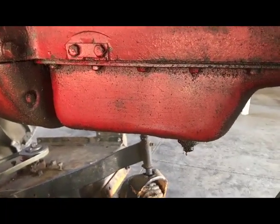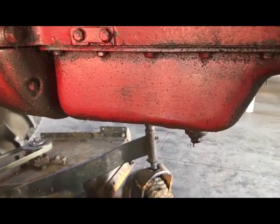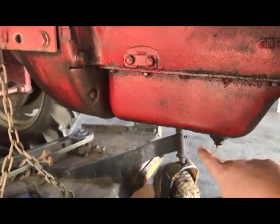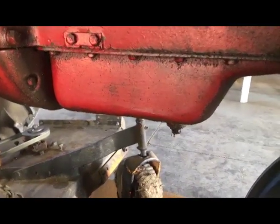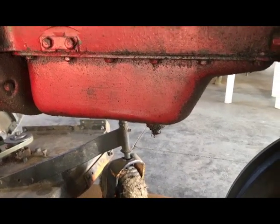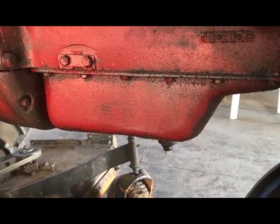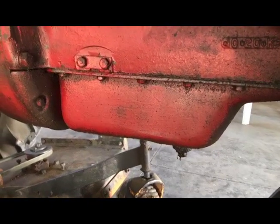According to the service manual it says you can roll them in in an emergency — it's not the best way to do it, which I know — but I want to at some point give this tractor a restoration. Right now I'm mowing with it and I kind of need it for that. So I'm gonna pull the pan and take those main bearings off and see if I can get some measurements and figure out if they're getting loose. I hope my crankshaft is in good shape. It feels to me like a motor where they did a top end and then didn't do anything else because it didn't really need it. It doesn't knock, so we'll have to see.